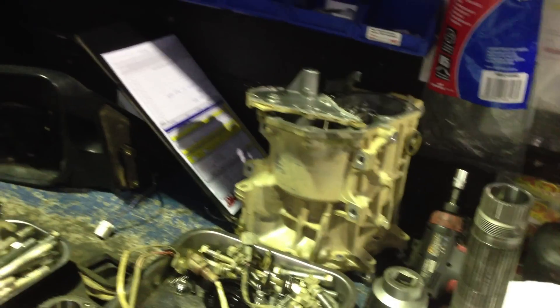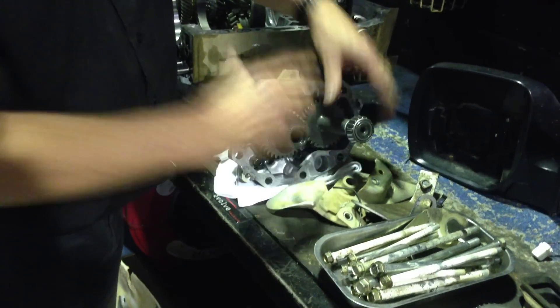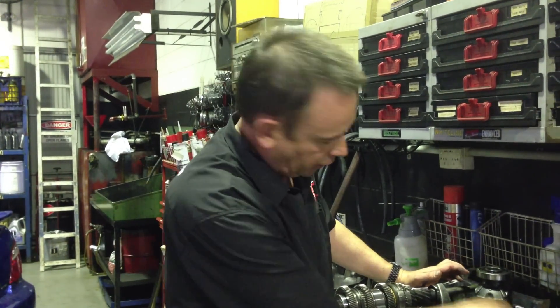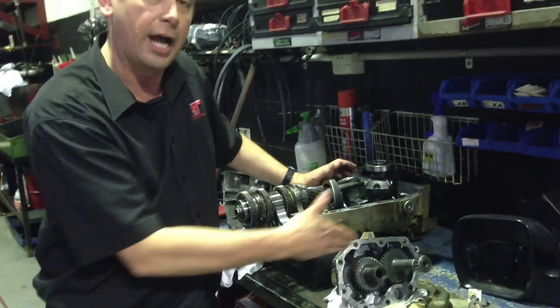On the back of the box is the whole assembly inside there, which sits the diff, and then on the back of that are the transfer gears — and you'll recognise the part that goes to the tail shaft. These transfer gears are one of the critical components that need to be matched to your gearbox when you're doing a transmission upgrade or replacement, to match the rear diff ratio. If you get the final drive wrong between the front diff, centre diff, transfer gears and the rear diff, you can end up with a situation like having a 20-inch wheel on one side of your rear axle and a 15-inch wheel on the other. One side will spin faster and the diff in the middle will eventually overheat and get damaged. The same can happen in a Subaru transmission if the wrong rear diff ratio is matched to the wrong front diff ratio. Also, depending on the year and age of your car, the bearings in those transfer gears on some model Subarus are what generate road noise.